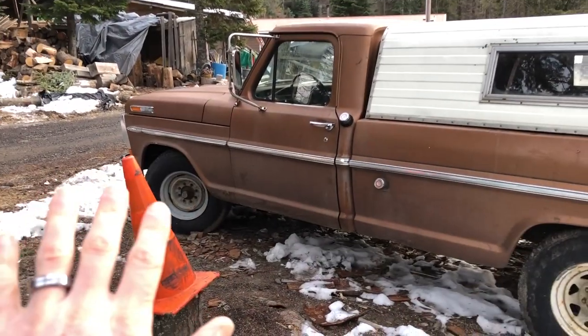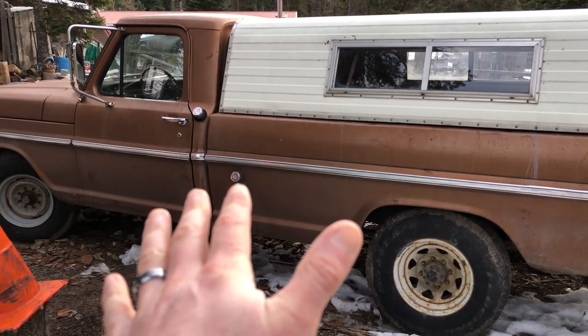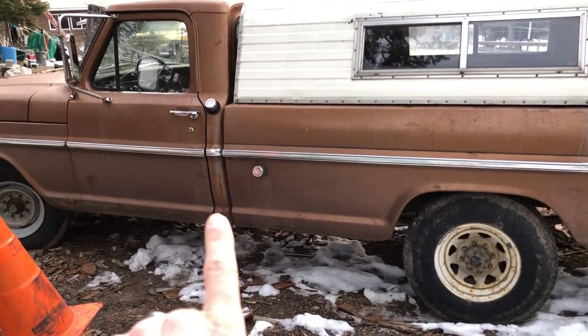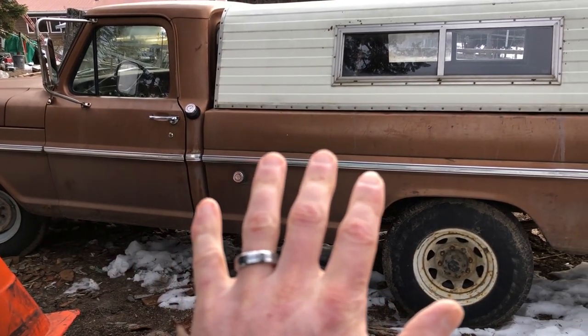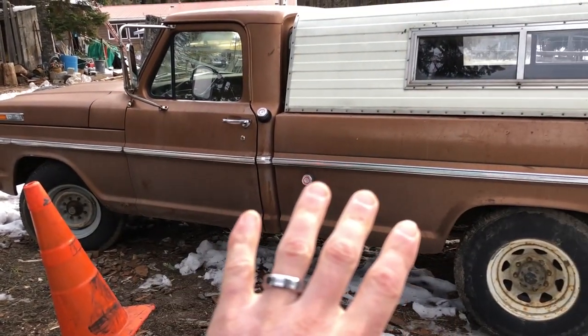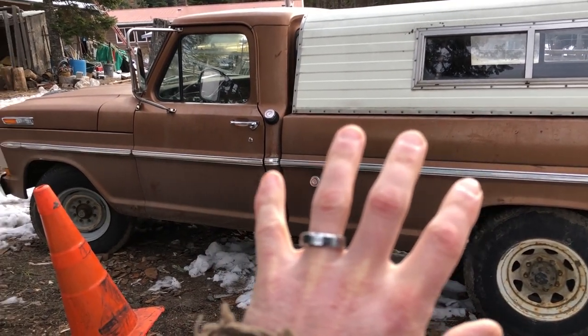Going up a hill, I'm not really concerned — it's always going to leave tension on the tow strap and it'll be fine. Another way you could accomplish that if you're on more level ground or towing slightly downhill: you can engage the parking brake somewhat on the vehicle being towed so that the vehicle won't roll on its own, but the towing vehicle's power can overcome that parking brake and just kind of drag it along.